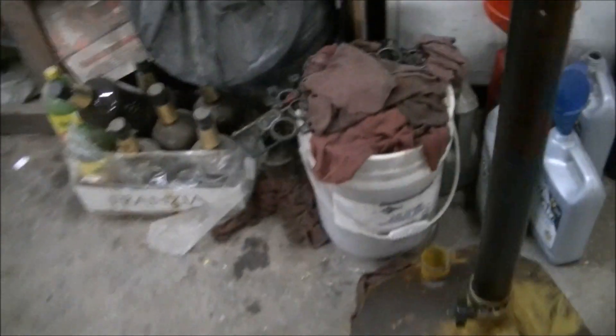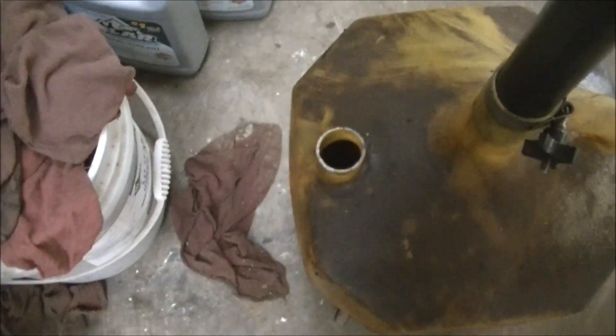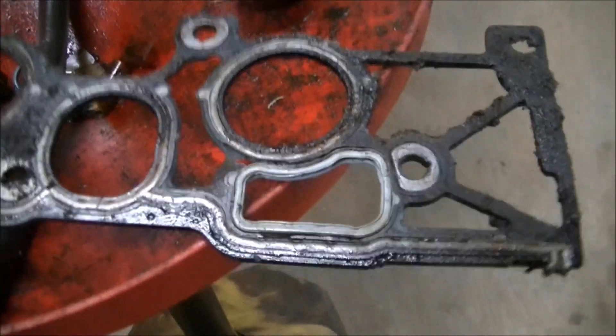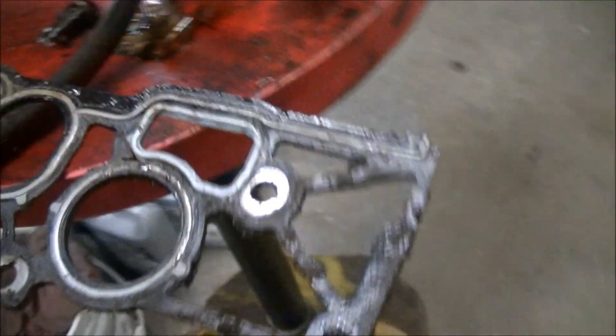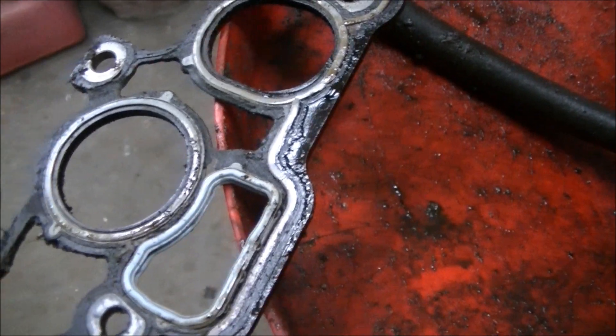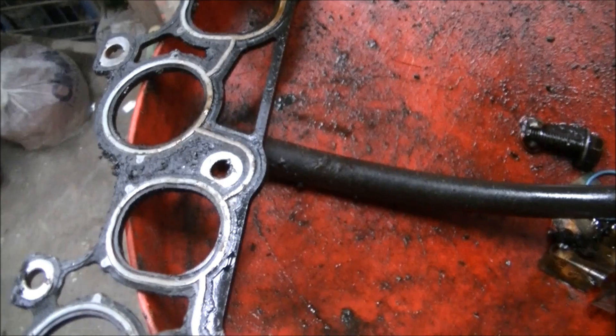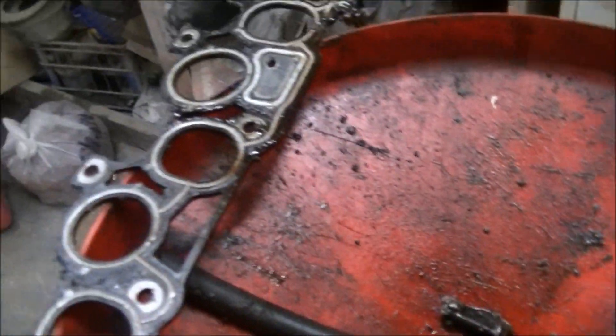She's tickled to death when I told her what it was. Here's the gasket that came off it — let's see if I can find which one it was. This gasket right here, you can see it leaking right here, coming back up the intake, pulling right out. And they were trying to sell her a head gasket for it — that's terrible.